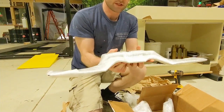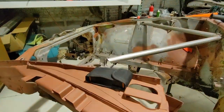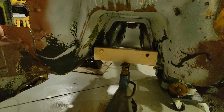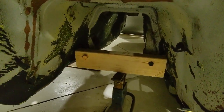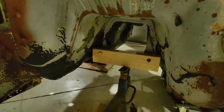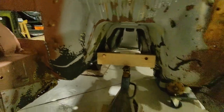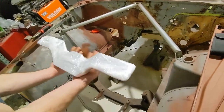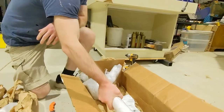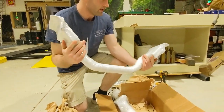This looks like the 370Z, 350Z transmission cross member, made for the CD009 transmission. See where I've got that piece of wood on the stock transmission mount ears there? We gotta cut those out, and I think a little bit of the cross brace that goes to the transmission tunnel. It shouldn't reduce the structural integrity because this is gonna sit bolted through the floor pans, tying that all back together anyway.